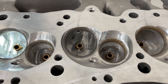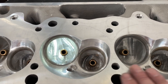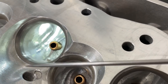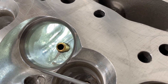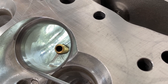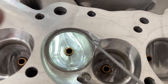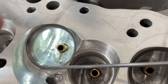It's not rust - it's wood dust. Ports are good, chamber is 119cc which works for most things. Now their CNC work does leave this little notch here - it's not very big but it's definitely a lip. Anytime air comes off the top cut and hits this, it really hurts your lower lift flow numbers. It's all the way around. It's not horrible - there's been some far worse - but it's definitely not helping things.